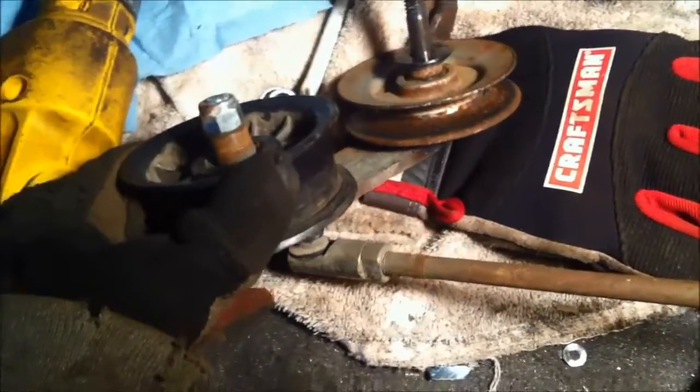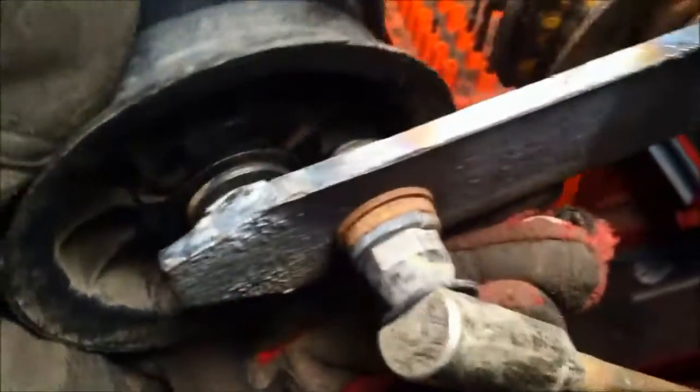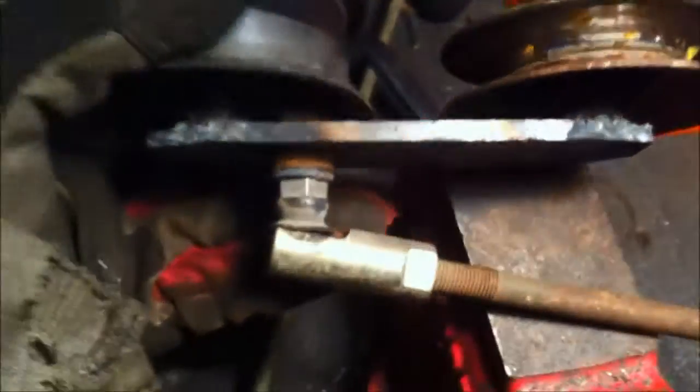Here's what I came up with — they got clutched together a little bit. There's a rod end, and I just drilled a hole. As you can see how close that bolt is, it's pretty close. I was going to put this adjustable end on there, but I mean, this is adjustable too. That pin would be in there — a cotter pin or something — but I didn't want that flopping around underneath in those tight clearances, so I used some spacers and washers. Obviously you're going to have to cut this in half and weld it and readjust it, but I have all these points of adjustment. So I'm going to throw this back on the tractor and start working on the pivot point.